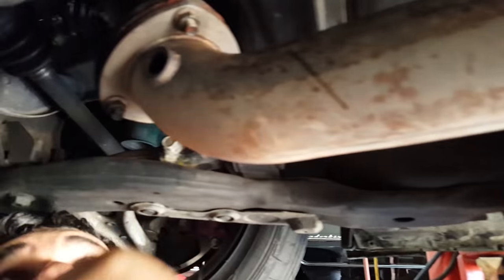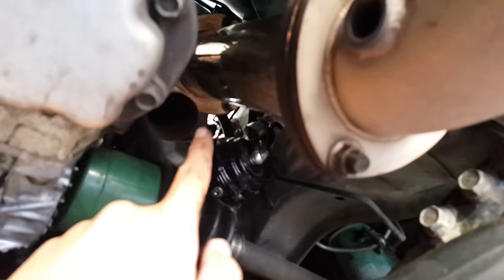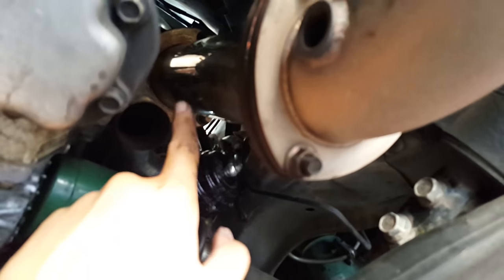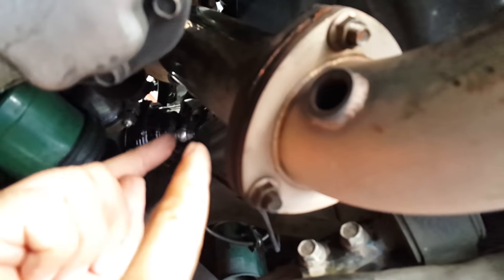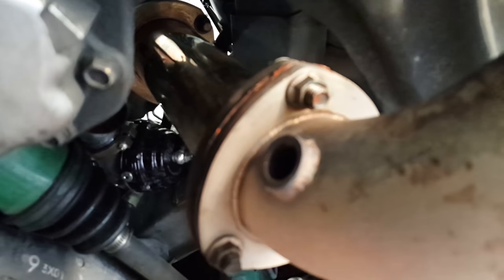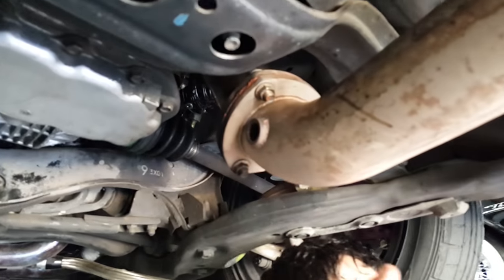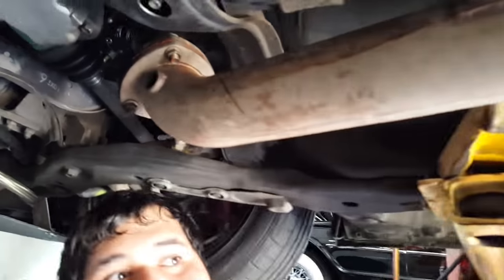We'll leave that on so it doesn't fall on us. So let's go ahead and get these 14s off. I'm going to go straight up to the top. Now this is what I was talking about — the three-piece. There's the bell mouth up there past this flange, which is full cast iron, heavy as hell. That piece alone weighs as much as the new downpipe. Then you got this piece, which is meant for a cat — if you wanted the cat, you could buy it and put it in place. But we're in Texas, this is America. And then of course you got this back half. So essentially this is a five-piece exhaust, but a three-piece downpipe.